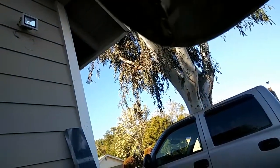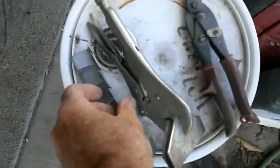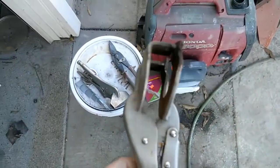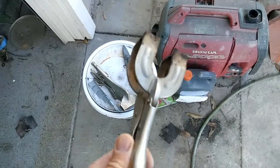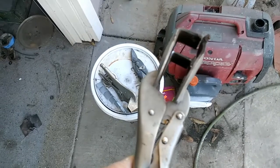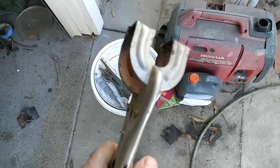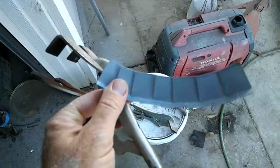That's why I use really fine sheet metal. I'm going to clamp this into place and then weld it in. It'll just form to the right direction as you do that. If you get this set of clamps it should have the proper clamp in there. It's a very difficult one to clamp into place, but I've done this a few times — almost every VW has the same problem. You can see this kind of bends into place fairly easily.